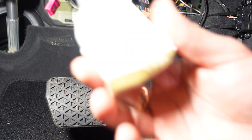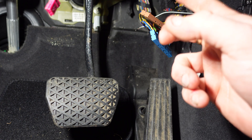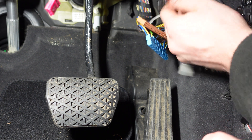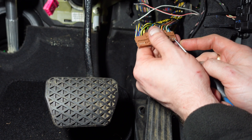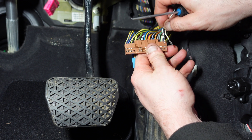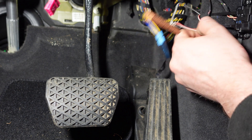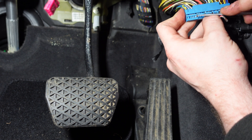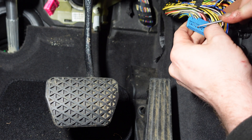For this upgrade, that's all you need to do on your pre-LCI cars — then clip your new LM2 module, put the adapter back on to clip it into the LM module and that's done. Now, because I'm connecting up my LCI lights I also have to install two additional wires. If you are doing the LCI upgrade: take the white and black wire and go to pin 62 — remove the pin already in 62 and push the new wire in — then connect the other wire to pin 5, which is along the back here.